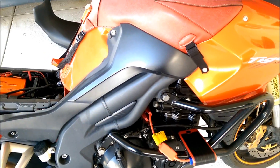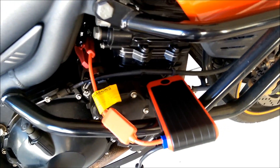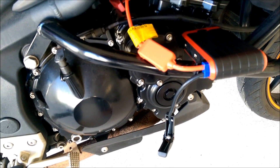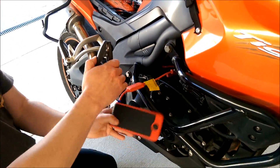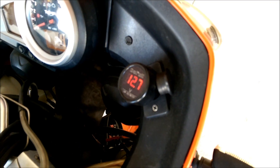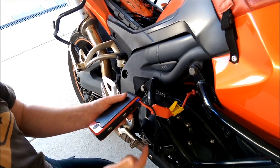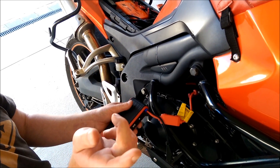The bike's hot and to cut the battery and electrics out of the equation, I've got a battery booster connected directly to the positive side of the starter motor, earthed onto the frame. It's still not starting even with the battery booster directly onto the starter motor — this is fully charged and it's acting like a flat battery. So that cuts the full electrics, earthing, and battery out of the equation.